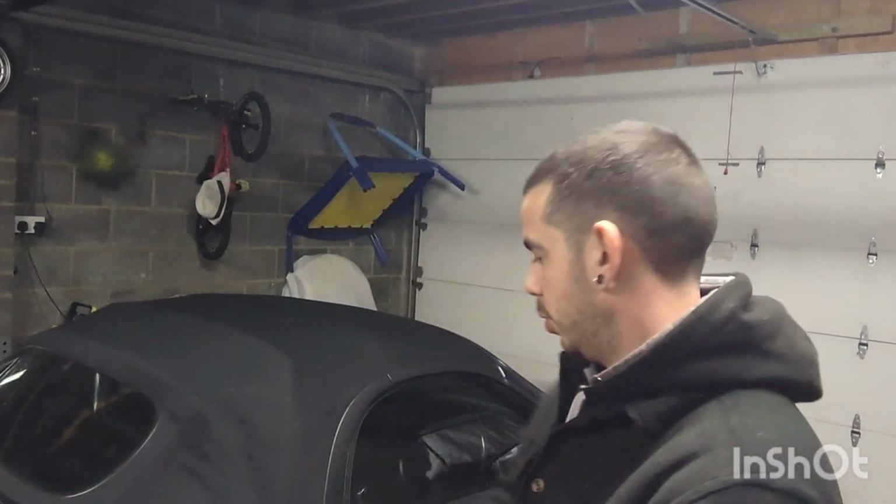All you need to do, put your key in your manual key lock, unlock the door, put the key in the ignition. Within 10 seconds or the alarm is going to go off, turn it to the first point on the turn, and the car will remember the key, will wake everything back up, and then you'll be able to use the button.